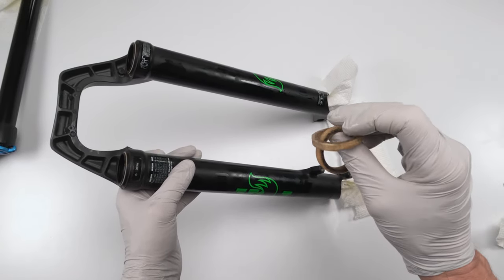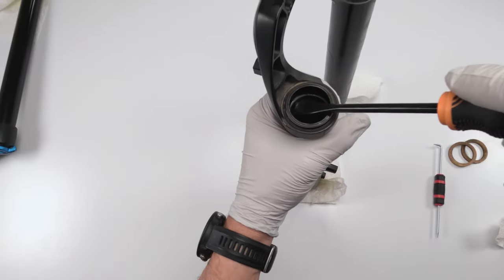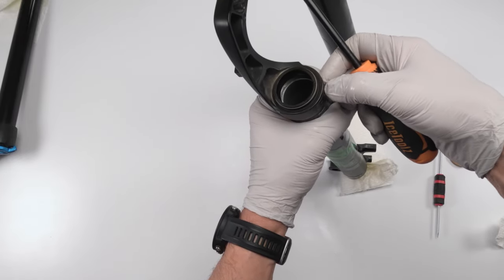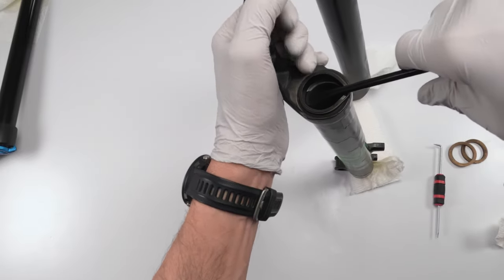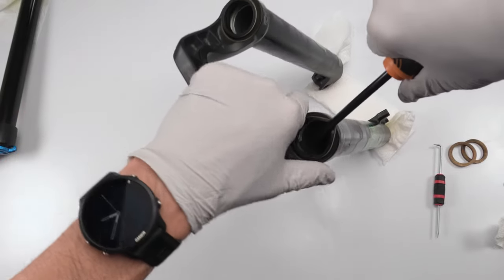They're not in all that bad shape, okay? Now, when it comes to taking out the wipers, again, I have this tool. You could use a regular wrench, like a large wrench, but large wrenches could chip the lower body over here, right? Or at least in this area, wherever you apply it. With this guy, we just put them underneath. The only thing is, being on a table, I don't have much leverage because of height.